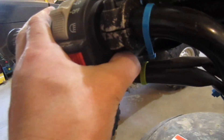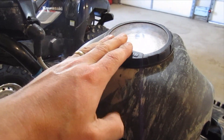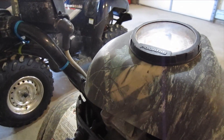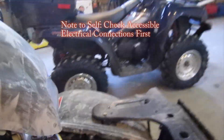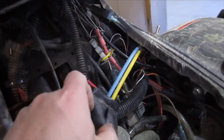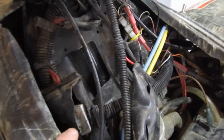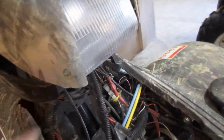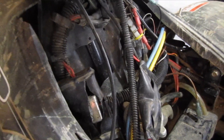This connector over here was just pulled out a bit. So if you're having a similar issue — basically no power to your speedometer assembly but you do have lights and the machine runs — just double check all your connections. Also don't forget about these circuit breakers; they're notorious for getting moisture in there, causing rust and failure. When that happens though, I believe you don't have any headlights at all, so that's a different situation. Good to know where those are and how to test them. Thanks for watching — leave questions and comments below.